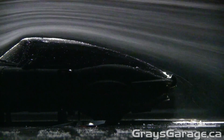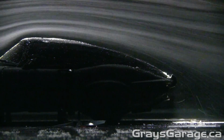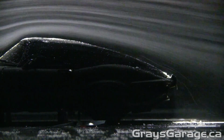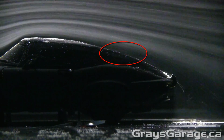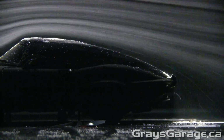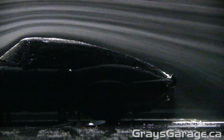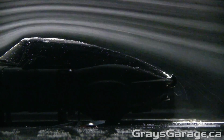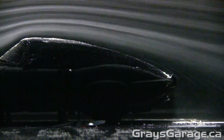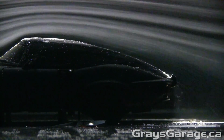Now, we were mentioning before that because you change this outline, this curvature, it may cause a different drag, and that's because the 2+2 may cause flow separation further upstream, and this would cause a higher drag. That's just due to the shape of the vehicle. And if that happened, we would have a larger recirculation at the back of the vehicle. Remember I told you that story about that editor who had exhaust coming into the back of the vehicle, and also blueing of the rear bumper? That may be caused by that larger recirculation region due to earlier separation on the 2+2 because it has a different profile.